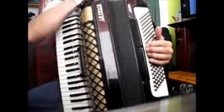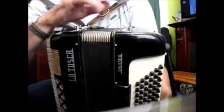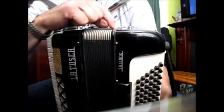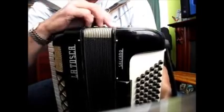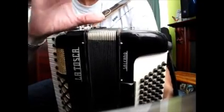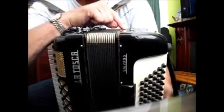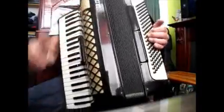There's a bit of an earwig here — you can actually see it coming out the top right here. You can also see where someone has fitted the bellows back on and they've just slipped with the gasket slightly. A quick repair would be to get some black silicone sealant, a small tube, and just finger it in there and smooth it over.